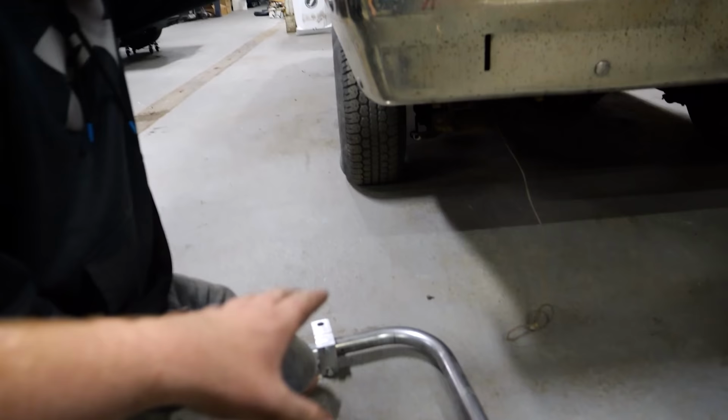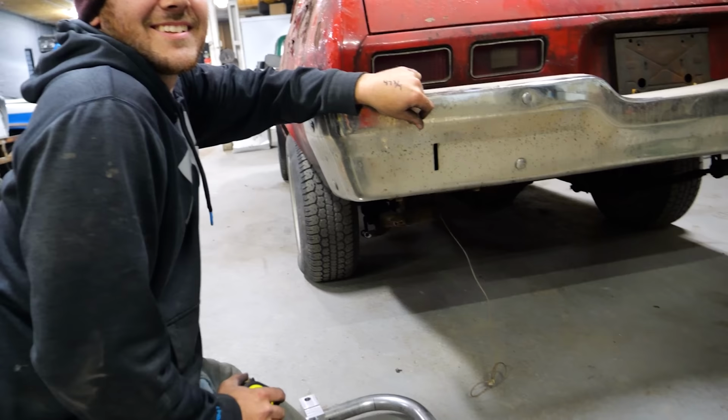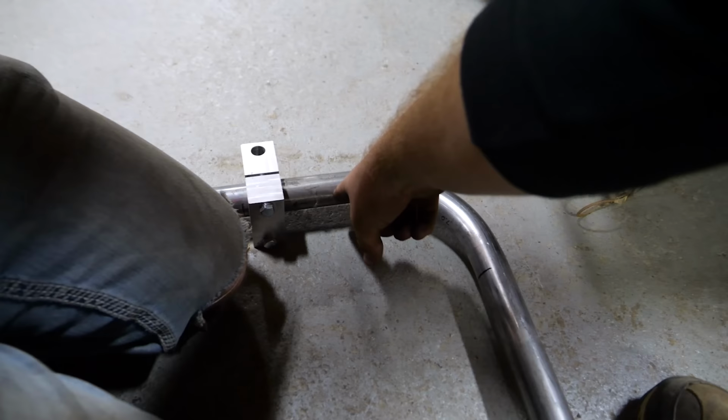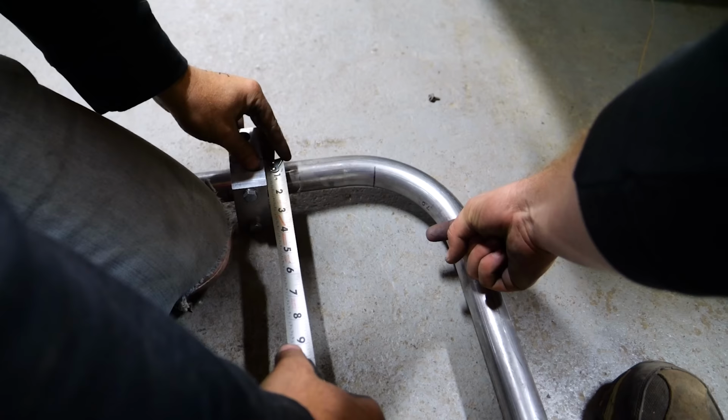All we have to do is make a stick over here, go that way. 44? 48, what was it? It's 4 feet, 47 and 3/4 inches away from that one. Yep. Easier said than done. How far is it from here? Center of this pipe to right here at the end of that bend, 4.5, which is our center line radius.